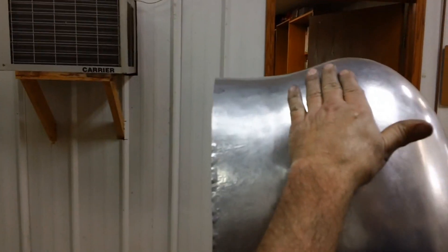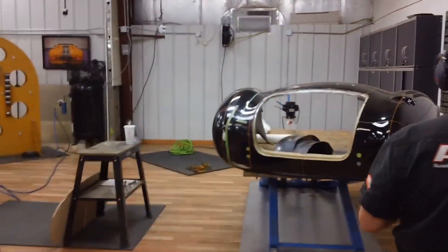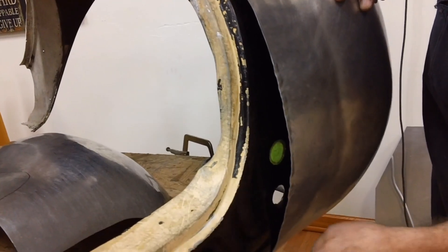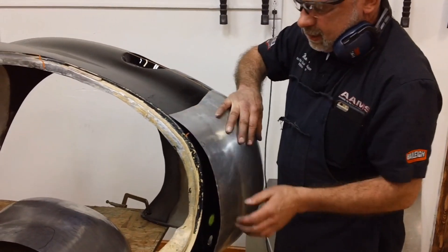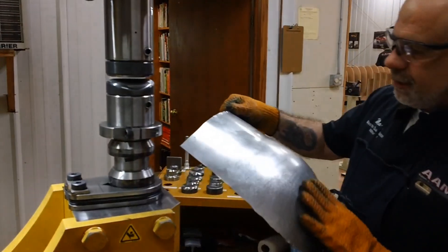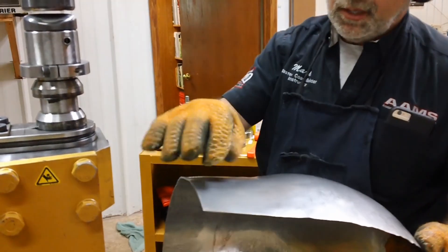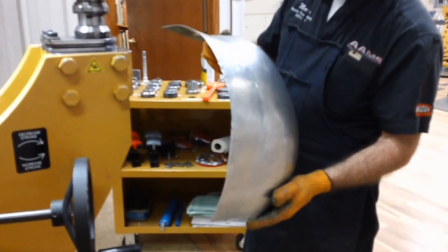You start to see what's going on — it's coming out. Let's go back here to the buck and look at it. You can see how much closer this has gotten and our fit down here. But we still have to bring it out, and we also have to bring the back down here, which is angled — that has to come out flat. So this has to be raised as well. By raising these sides, that will make the center go in. This is the bottom side — it's got a little hump in it here, that actually needs to come off flat. I'm going to raise this area, bring this up a little bit, and also bring this out right here a little bit more, and then we'll see if we've got what we need.